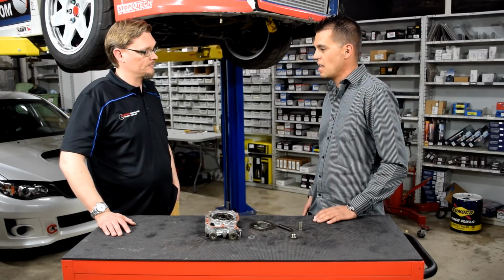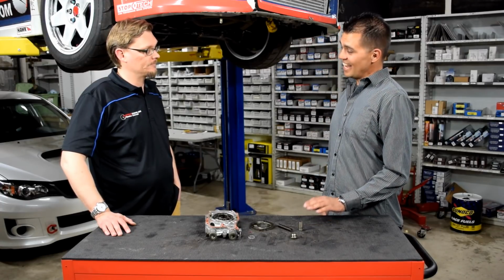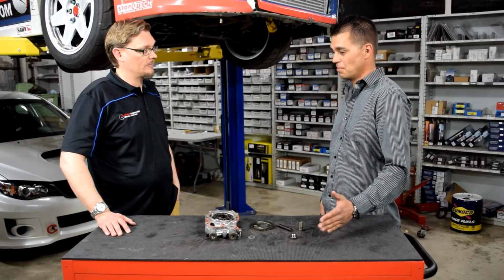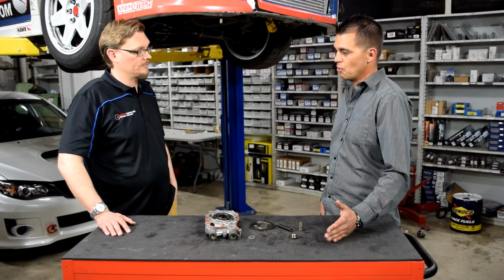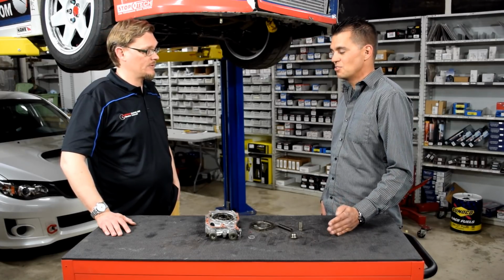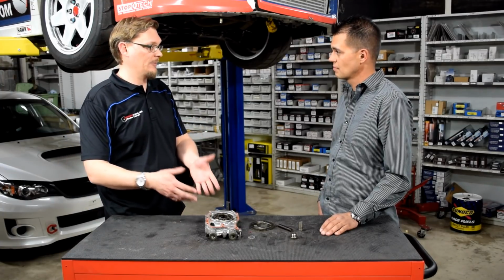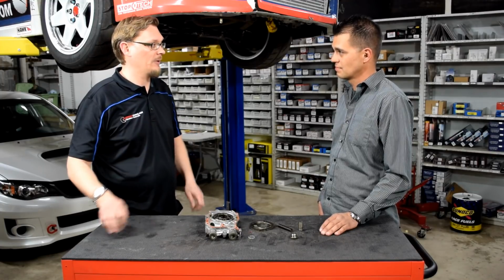Track temps again. Now it's getting the oil temperature up. What I noticed is that I actually still had a pressure drop, but it wasn't to 60 psi. I'm seeing, with the same oil, up to 70 psi. So now we've come up almost 10 psi with the larger volume pump, even compared to the 10 millimeter pump shimmed, in that problem area at high RPM at the track.